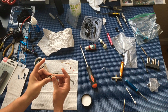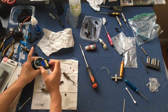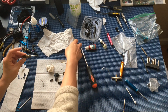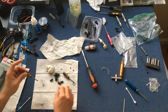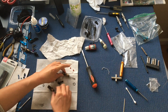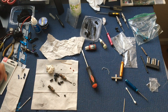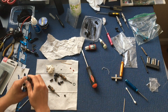Whenever you see a torn or worn-out o-ring, you want to replace it, or else you're going to have leaky shocks. Those leaky shocks will manifest — if you're running off-road, you'll see a bunch of dust and dirt clumped onto the shock body and around the lower spring mount. You're just going to have a bunch of gunk: oil, shock oil, and the grime it picks up.